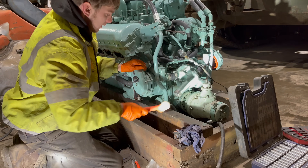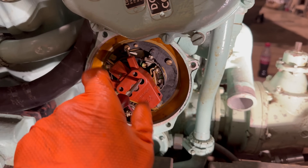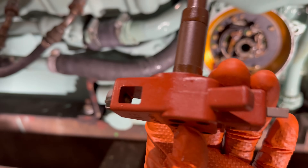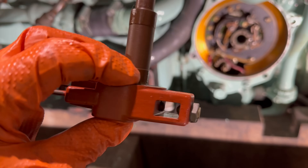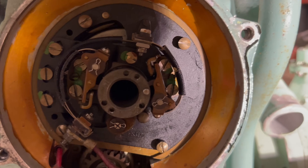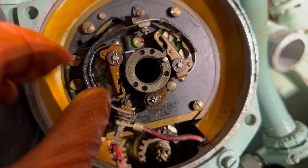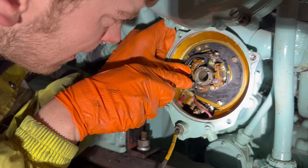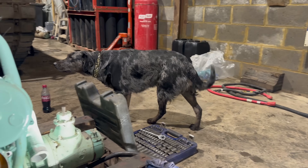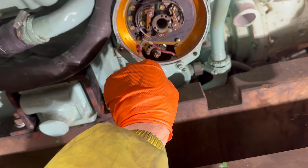Next, I'll start by taking apart the exhaust mag, and I can do the same again — cable-tie the cap out of the way and get the rotor arm out. The rotor arms actually have centrifugal overrun protection, so you can't rev the engine too hard and blow it up. Again, the magneto looks in perfect condition with just a tiny bit of corrosion on the points. We'll clean them up now and we should be good to go. There is a fair layer of corrosion on the end of these points. And again, because there's two mags, you need two earth wires to kill the engine, else it'll carry on running on one.